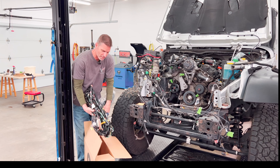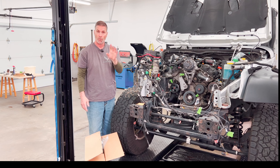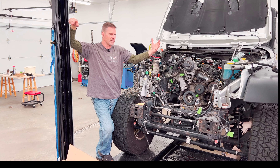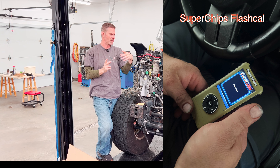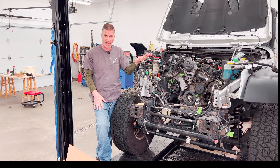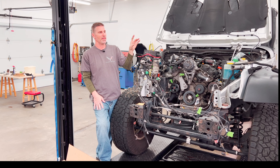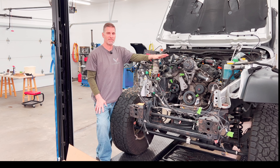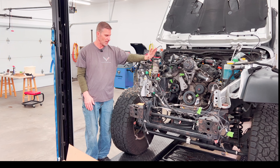The swap kit comes with an engine harness for the Hemi. You take out your Jeep computer and send it in to them. One thing my son mentioned when talking to Dakota Customs — we have one of those tuning controllers, a green one, 'Cal something' — but it's useless now. What they said at Dakota Customs is you have to reset your ECM back to factory specs with that controller so the Jeep thinks it's back to stock. If you don't, they'll have problems programming it for the Hemi. So if you use that controller, make sure you reset everything to factory specs before you tear the harness apart — don't make the mistake of forgetting like I did.